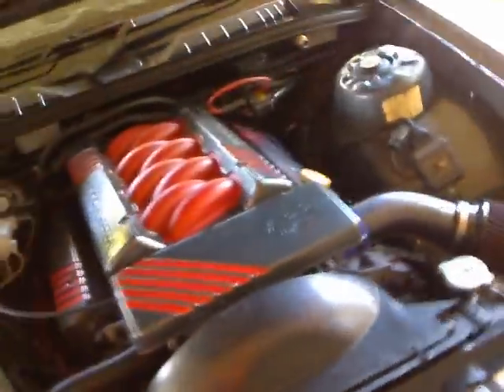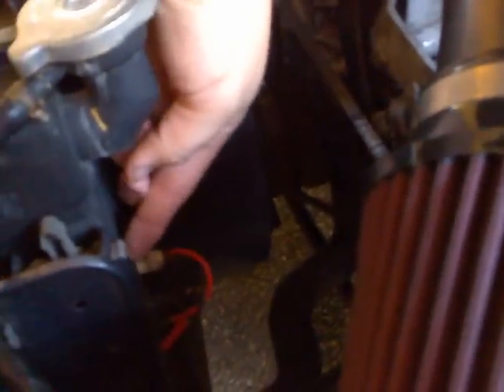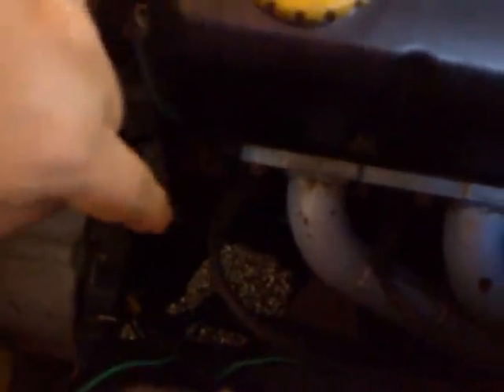With the actual two types of sender units - the temperature gauge sender is actually in the radiator, there was a thread and it fit perfectly. The oil sender, as you said it might be a bit dark, but it's down under there where the oil switch was, and then grounded.